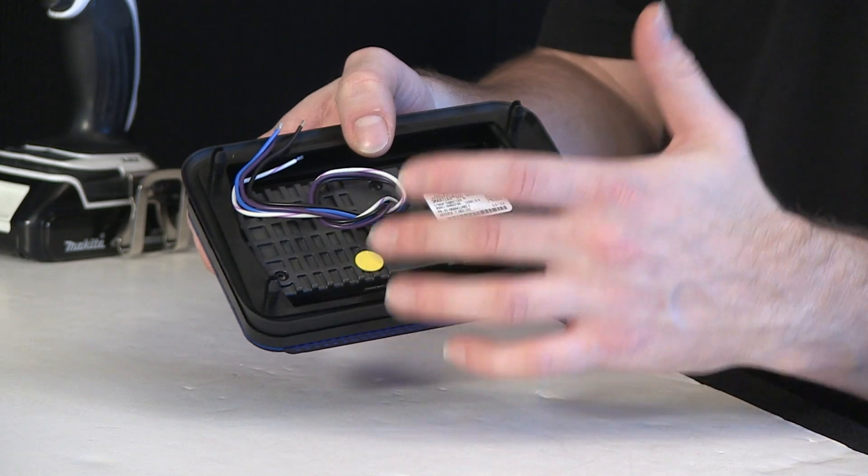The scan lock wire is a momentary process. Take your 12 volts and give it a quick tap — each tap advances it to the next flash pattern. Once it's selected to one that you like, simply stop the process, leave it applied to a ground source, route them to your controller in the vehicle, and there you have it. Whelan has something in here that'll really suit any need — there's fast, there's slow, and there are even a few patterns that are more randomized.